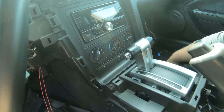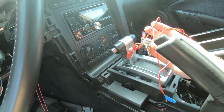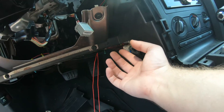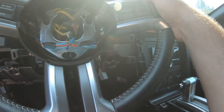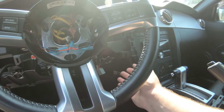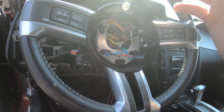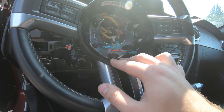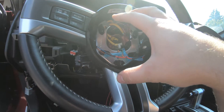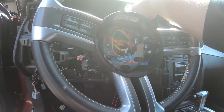Those are only three pins. I'll take three pins and connect them at the bottom and route them up through here — that'll be a bit cleaner. Ultimately I'll get these butt connectors out of here, have straight connectors, and I'll be able to put this toggle switch in. I'm thinking about putting the toggle switch somewhere down here where it won't really be seen, and I can easily just flip it to go to my paddles. I also have my push start kind of in that area. So we just have the two power lines and the two grounds going into one to three pins using the clock spring because it's designed to rotate — no binding up of cabling.